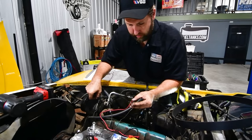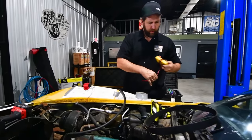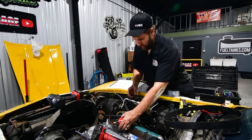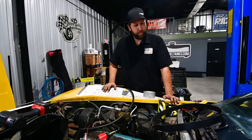That looks great. So I got a wire here that used to run the choke. With the key on, I get 12 volts. So I'm gonna hot wire this fuel pump into here, and then I can start extracting some of this old fuel that's been sitting for 74 million years.